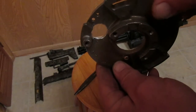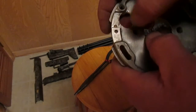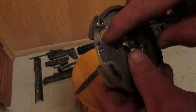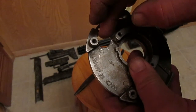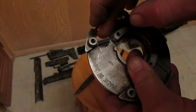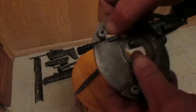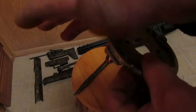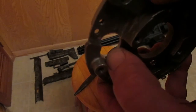Now you can see I've opened that hole right up. There's plenty of room for the wires to come through. The only thing we need to do now is make it smooth enough all along the edges so we can permanently eliminate the wiring getting cut from vibration. All we've got to do is a little filing, a little sandpaper on both sides — round it off nice so you can put your finger right through there. If you can stick your finger in and twist and not get cut because it's smooth enough, then you're definitely not going to cut wire.